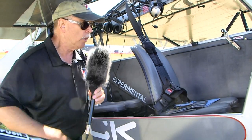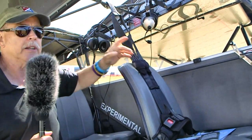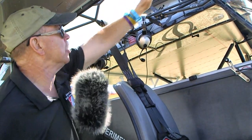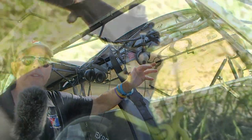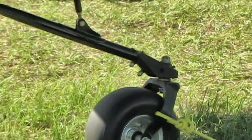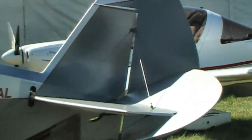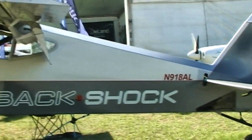That's pretty easy. One last thing, I mentioned the structure up here that you use to get in the airplane. They have deliberately designed the aircraft to remove the cross brace that normally goes right about here in this style of airplane. If you're operating in Alaska, where there are some fairly rough conditions, pilots often wear a helmet, and if the helmet were in here, you'd be banging up against that tube. So they have re-engineered this structure to leave all this area open, so even a tall guy could wear a helmet in there without bumping his head.